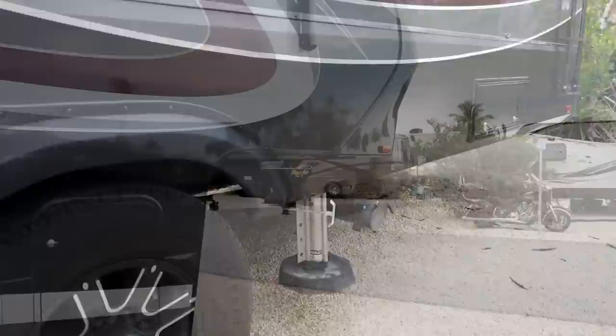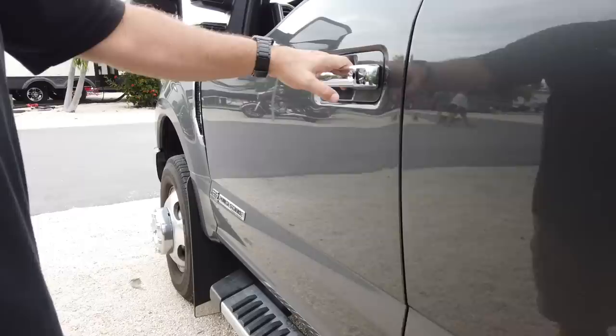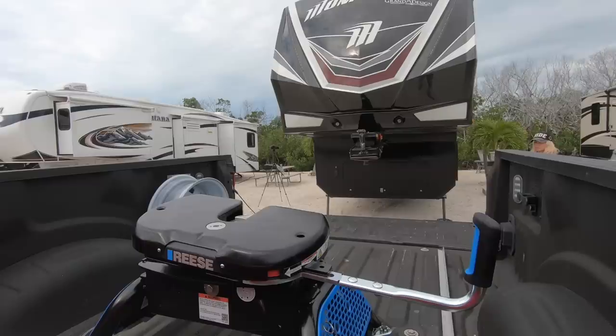You can see it's pulling the rear ones up, and then it will jack the front up. All four middle and rear jacks are up, and the front jacks came up to about where it thinks it should be for hitching. We may have to make some adjustments. Some other checks we do are in the truck: tow haul mode, mirrors extended, TPMS is already on. We'll swap out our EZ Pass if we're in the northeast — we've got one for the truck only and one for the truck and RV. Tailgate is already down.